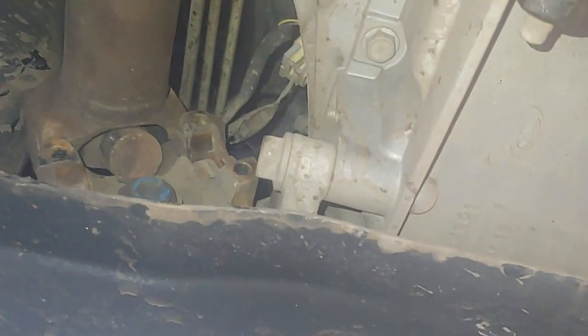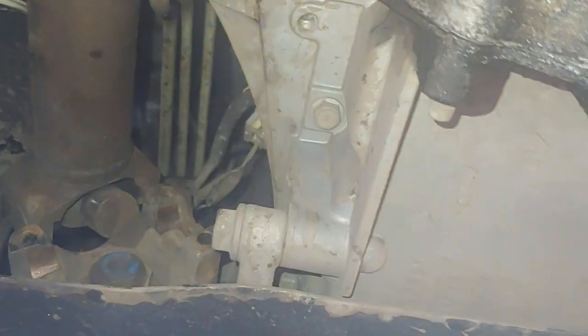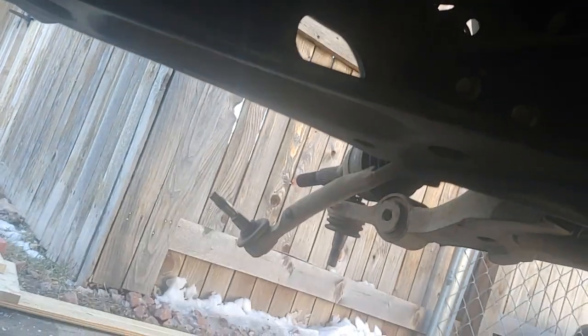What I noticed is there is a little space up here where you can rotate it and rotate this part right here. You should be able to slide the drive shaft up into this little cavity up here to get a better angle. Popped out of the back, slide it up a bit more, lift it down, wiggle it out of the cavity — and we've removed the front drive shaft without disconnecting this cross member.